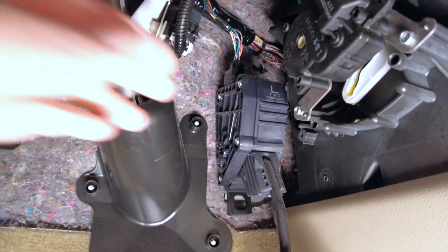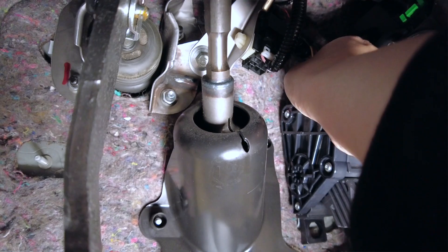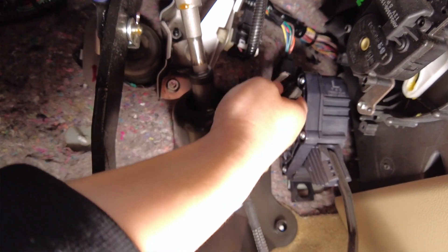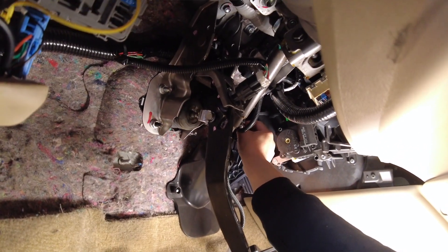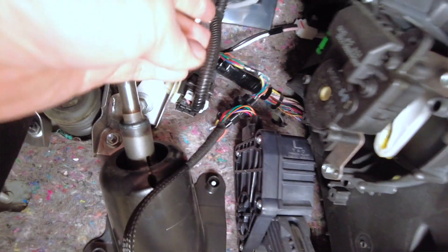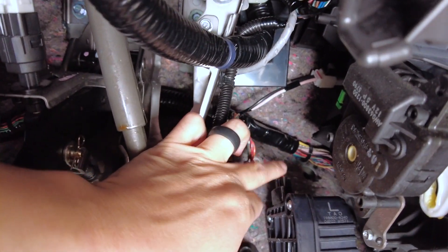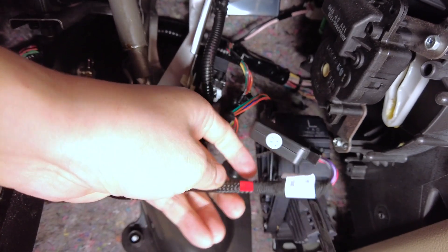All right, here's the plug. I'm going to pull this out with one hand. The release tab is going to be on the right side — feel it and just push straight up. Very easy. Grab our kit. The female side of our kit will plug in to this device. The factory original connector is plugged into the female side of our harness, and the male side is connected to the acceleration pedal. Then we're going to connect our switch to this and route it to your desired location.